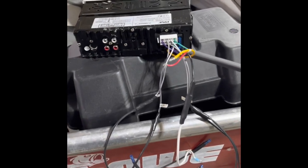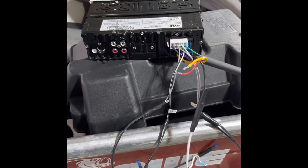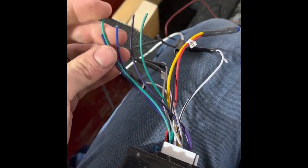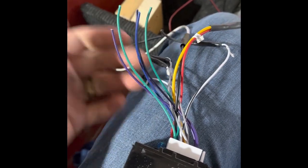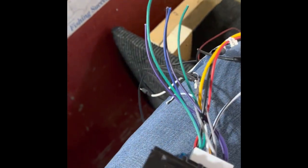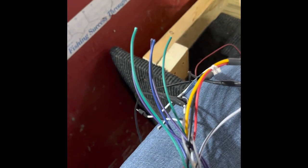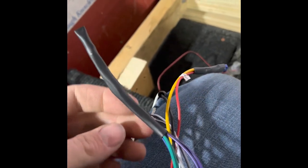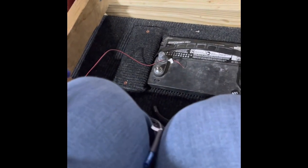I just wanted to hop back and share that tip. My third tip is: say you have all these wires for different applications within the wiring diagram — what I like to do is take a piece of your heat tubing and slide it over all of these. Here's what I was talking about. I just heated the tube up and then pinched the tip while it was pretty hot, so now that's closed off. You won't have to worry about it and it won't get in the way as much.